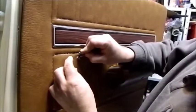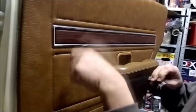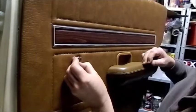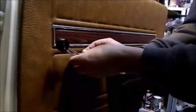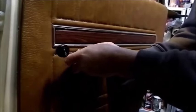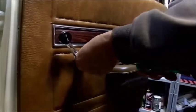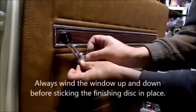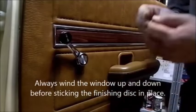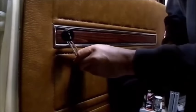We've just got to be very careful when we cut around here — we should use a modelling knife. We don't want the window winder handle grabbing the vinyl or the foam and buggering it up, so I'm going to go around here gently so that spindle can turn without gathering or grabbing any of the vinyl. Then we just grab this insulator and stick it behind. Stick our screw in and put it into place. Beautiful — I'm happy with that.